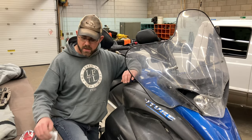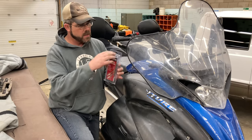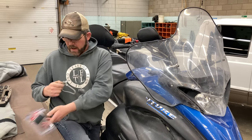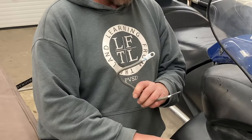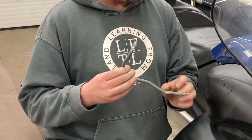To accomplish this, I'm going to use two stainless steel bolts for the terminals. The second thing I needed was a short expanded battery cable — I got 15-inch cables from Canadian Tire, but any parts store will have them. They're pre-made: one side goes to the battery, the other to the back side of the terminal coming through the cowl.